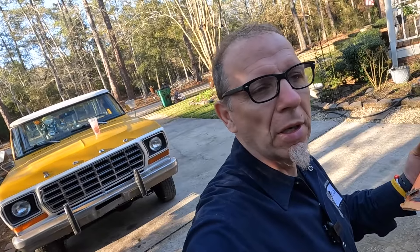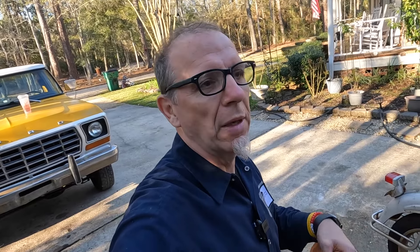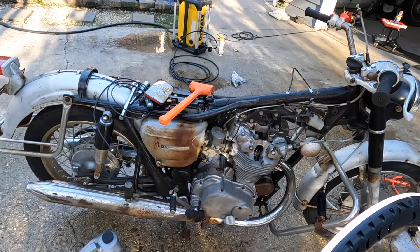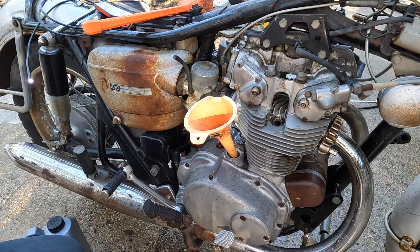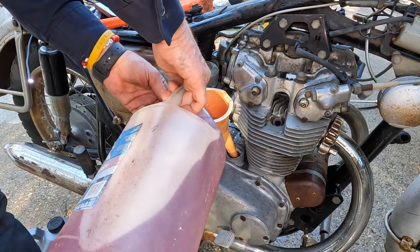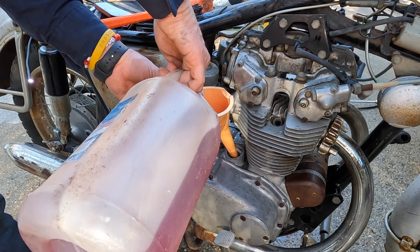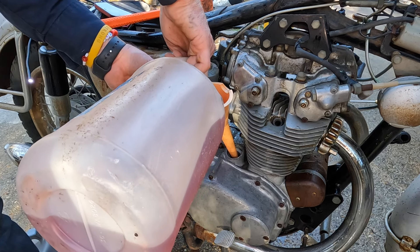It's going to have to come all the way apart anyway. The easiest way to get it apart is to get it unstuck first — I've got leverage with it mostly together, as opposed to putting it on the bench. I'm trying to soften it up as much as I can before I have to wallop the pistons with a mallet and a piece of 2x4. I'm going to start with some diesel because I've heard good things about it and a friend dropped some off in a jug. I'll fill it up and let it do its magic.